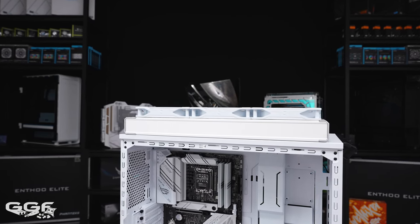With a bit of twisting I was able to install an EK P420M at the front, then mount the cable management bar back. Although there's room for a thick 60mm 420 radiator at the front, I couldn't get an EK X420M to fit even after removing memory and the air duct. Personally, the two best radiator configs are: a thick 360 at the top with a medium-size 420 at the front, or two thick 360s — one at the top and one at the front. The rear location supports either 120 or 140mm fans, which is always nice, though I'd only use it for fans rather than a radiator given the tight top clearances.